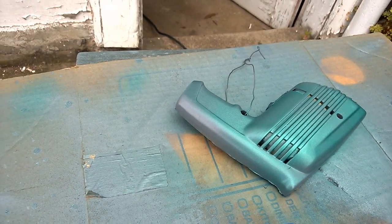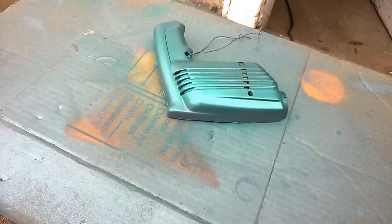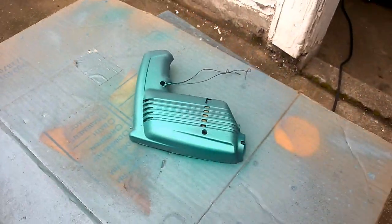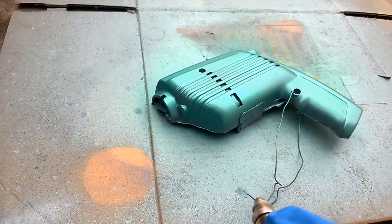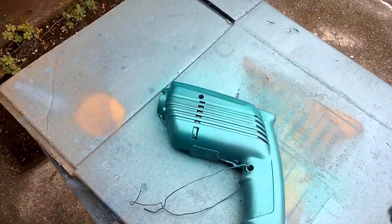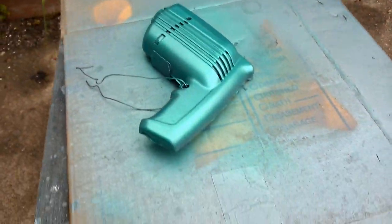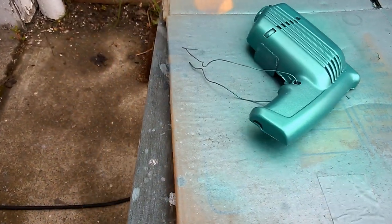The base coat looks a little hazy for now, but you can see it going on nice and easy — it's going to look terrific when done. Light coats — we're doing several of these. No need to try to get full coverage on each coat; you'll just wind up with runs and drips. Going very carefully, spraying back and forth, trying to get every nook and cranny, not worrying about full coverage. About five minutes between coats is enough, especially for a waterborne paint. Standing seven or eight inches back removes any risk of a paint run. Aiming toward the edges too — that's always a worrisome spot.